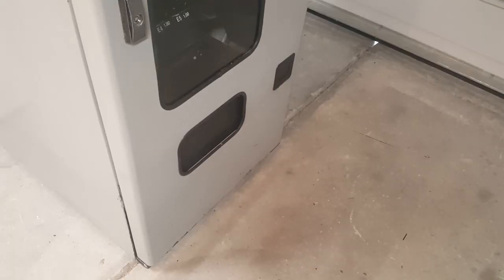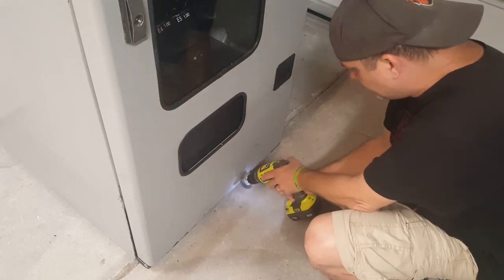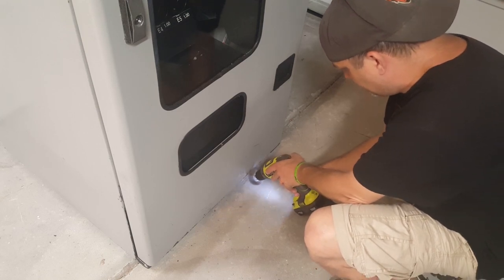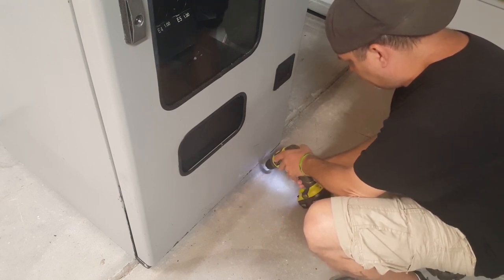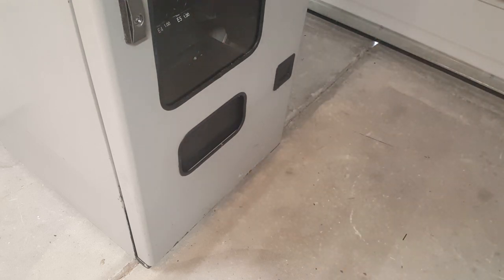So first of all, at the bottom of the machine, there's some rust spots. Now, when I got it, the bottom strip was painted. So I had to remove the paint, and that's where the rust spots were exposed. So what we're going to do is address those rust spots. First, we're going to hit them with a wire brush so that we can get rid of the rust. And then we're going to do a fine sanding and clean it up before we give it a paint job.